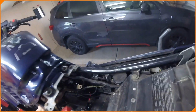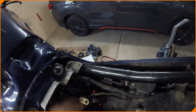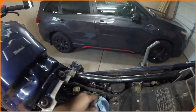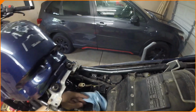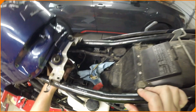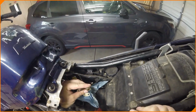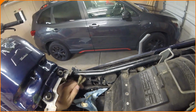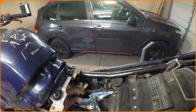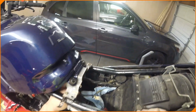It does not have an airbox. Has some wonky stuff done because it doesn't have an airbox, including some zip ties in places that we're going to unzip tie and clean. And then it's got some wiring that's just kind of floating around that we got to figure out. Does it go to something important like these two? Probably something important, right? Like these are just some big plugs. Figure out what those go to, if they're required or not. Are they just diagnostic ports? Doubt it.